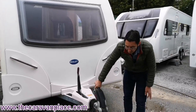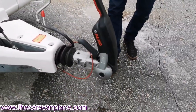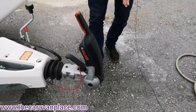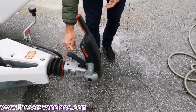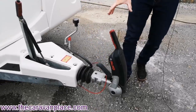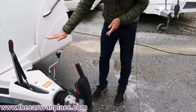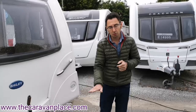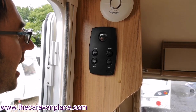The Alko AKS hitch head — when you come to collect the van we'll run through this and make sure you're happy with hitching up. We have got another video that goes into a little bit more detail on this. We've then got the breakaway cable — an important one. As we're hitching up, the breakaway cable must be connected; if the caravan were to ever come detached from the car, the breakaway cable will pull the handbrake on and stop the caravan. Then we've got our jockey wheel to raise the caravan, get it fairly level, and raise or drop it onto the tow ball of the car.